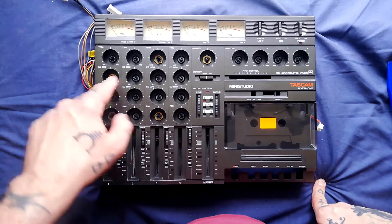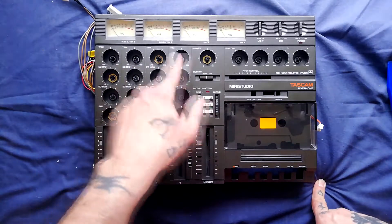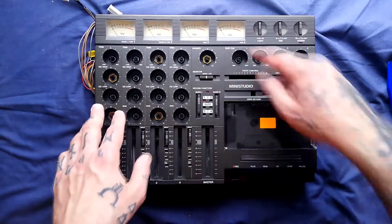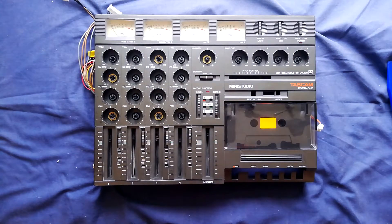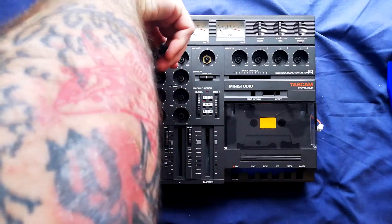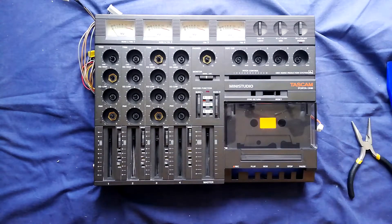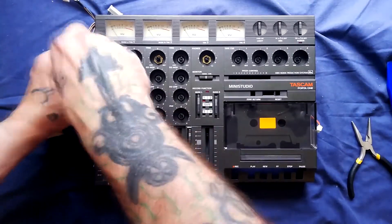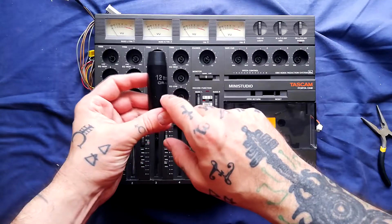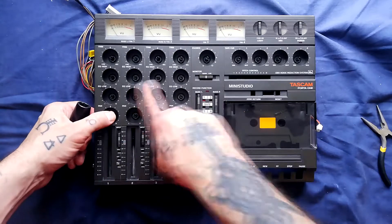I'm not exactly sure whether these brass nuts that you can see in some of the holes are in the same places they were when this unit was originally opened, but once you remove those knobs you're going to find a few of these. If you don't have a socket set then you can get in here with a pair of needle nose pliers and unscrew them that way, though that's quite awkward. If you've got a socket set, that's by far the quicker way. That was a 12mm socket that I used to remove those brass fixings.